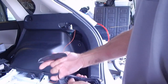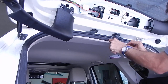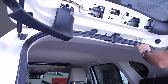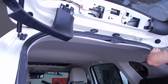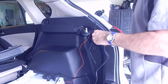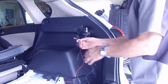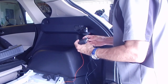Now I've got the power lead run to where I want the control unit. I'm going to mount the head unit on the back of the vehicle on the inside, right on the headliner, so that when you look in your rear view mirror you can see the LED lights. The buzzer is kind of loud so I didn't want to put it up front — you can hear it really well from the back, and it makes sense that it's buzzing from the back so you know something's behind you. I'm running the control wire for the LED panel with the buzzer, routing it into where I'll mount the control box, and then plugging it in.